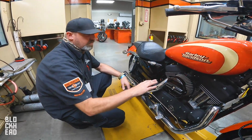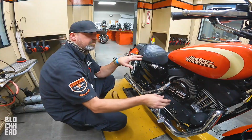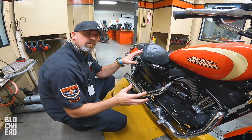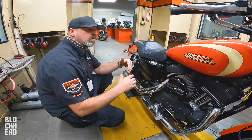Students will do one and the other, will measure it, and then they take the bike out of here and they get on the computer and they adjust the map, one student does one cylinder, one student does the other. And then when they're happy with what they've changed, they'll download the bike with the new map, and then they come in here and measure it again and find out where they are today.